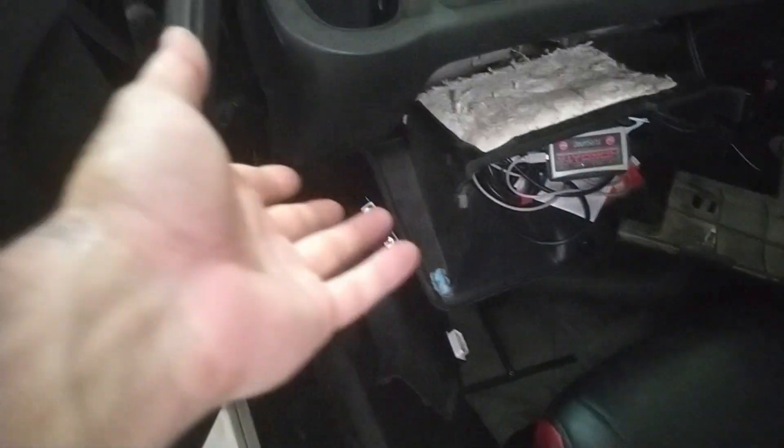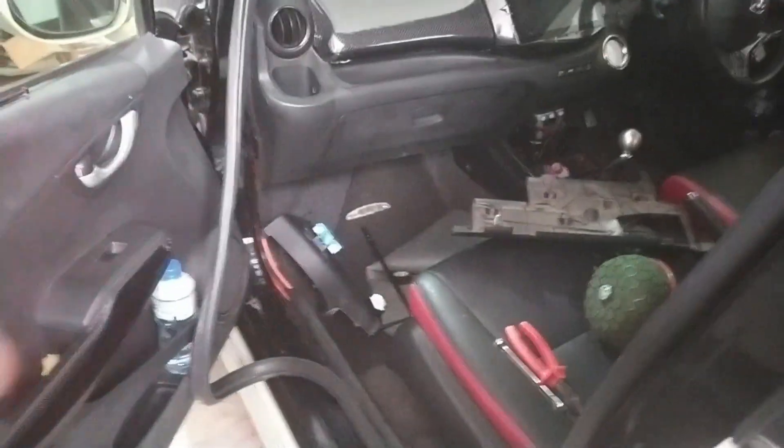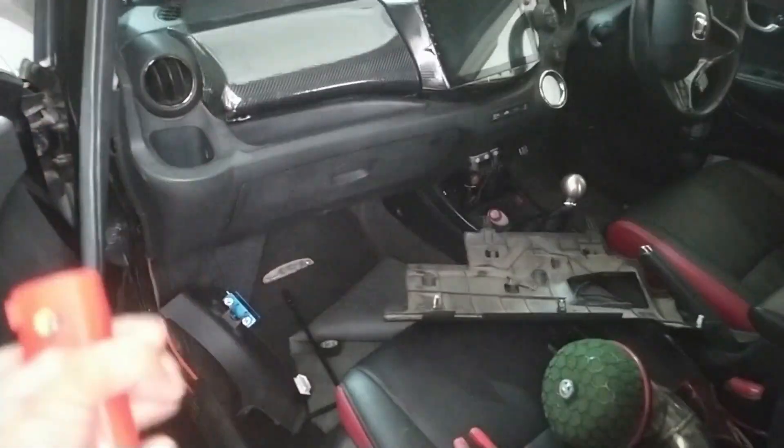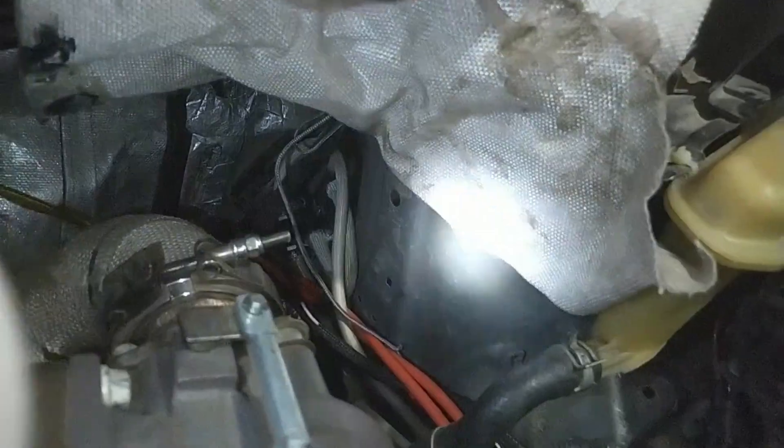Right now I am in the middle of shifting my dual stage boost controller to the engine bay, because this device is not rust proof so I installed it on the inside. These are the settings for the low boost and high boost. The problem is if I give it the vacuum source from the intake manifold it acts like an air leak, because air is being sucked from here. And if I give it vacuum directly from the turbo, it creates a very irritating loud sound — the air leaking sound — so it was annoying inside the cabin.